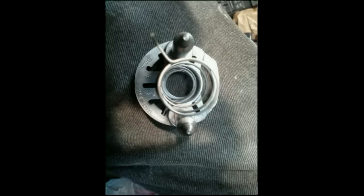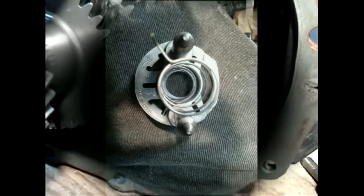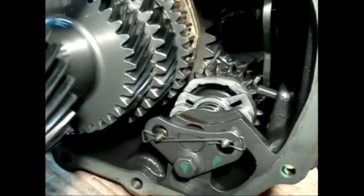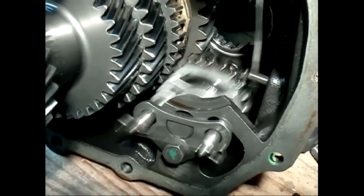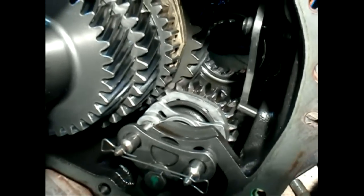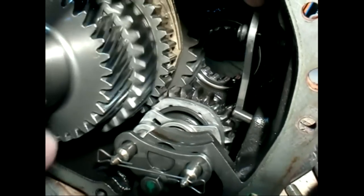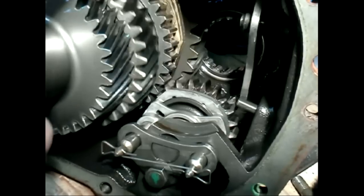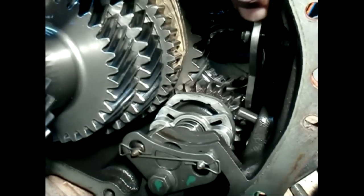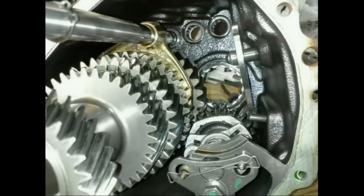The reverse gear uses a different type of synchronizer. To engage reverse, you stop the output shaft from turning by coming to a full stop. When the attempt is made to put the car in reverse, the synchronizer helps to slow down the speed of the input shaft so it can also become still. When both shafts are still, the idler gear can easily slide between them. Depressing the clutch disconnects the input shaft from the engine, which allows the synchronizer to effectively apply its braking effect.